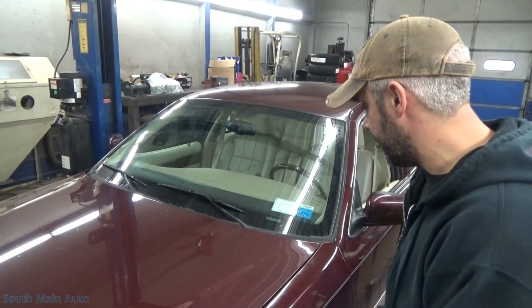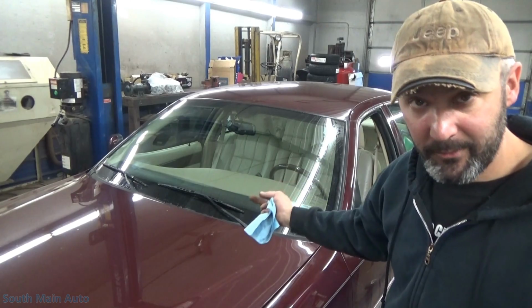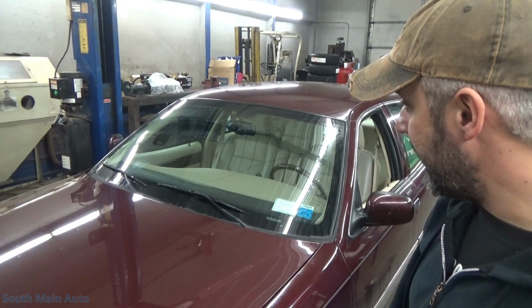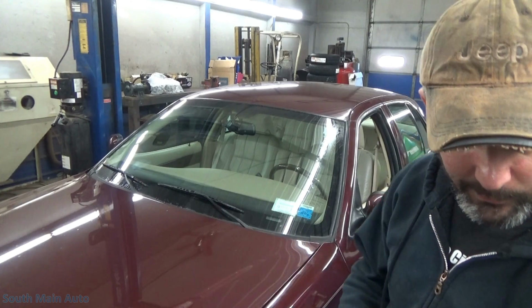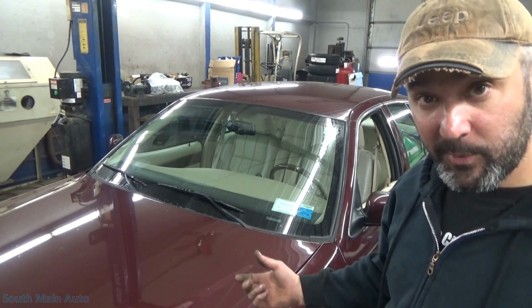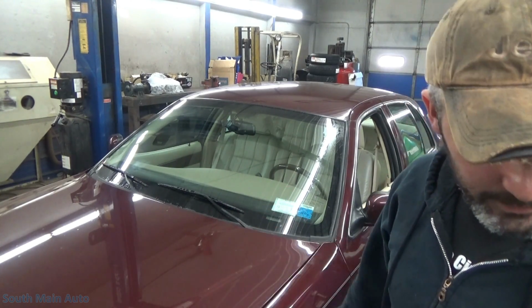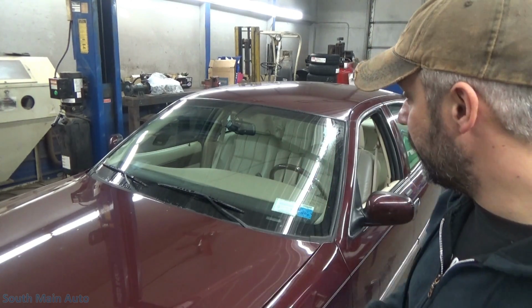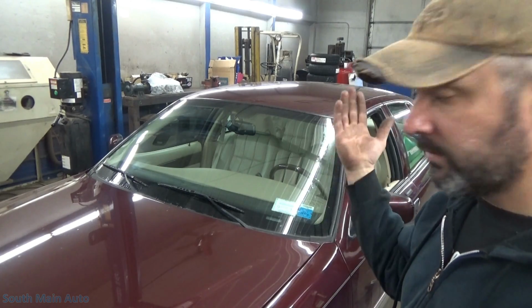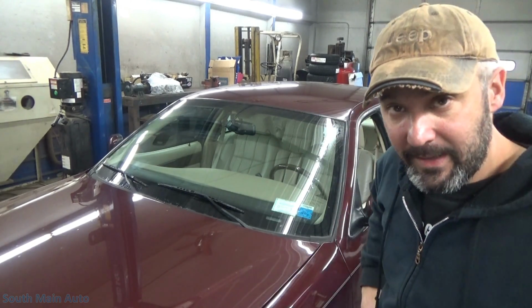In the meantime, I gotta get motor in. He's got some problems with the automatic HVAC unit. Apparently it goes to defrost when you're scooting down the road. Everything is vacuum controlled. The temperature blend door is not vacuum controlled, but everything else is, all the modes are, rather. So that's it, I gotta keep motoring.